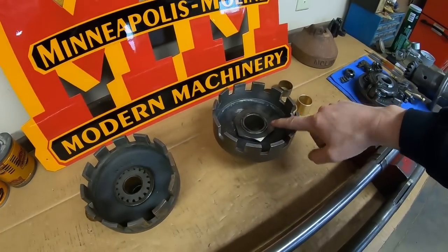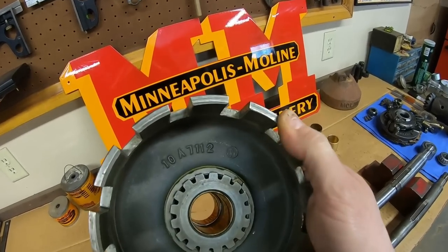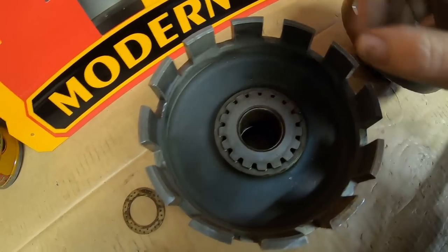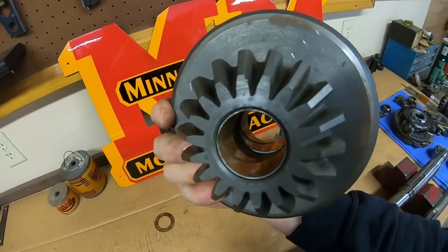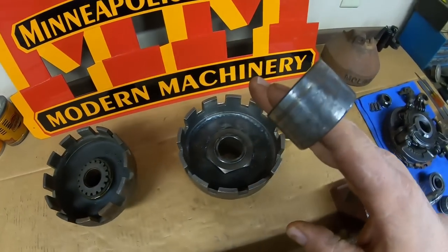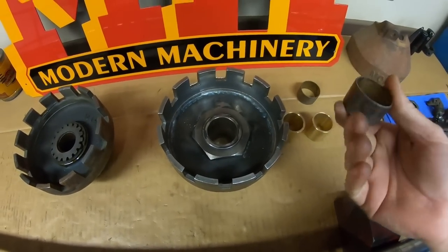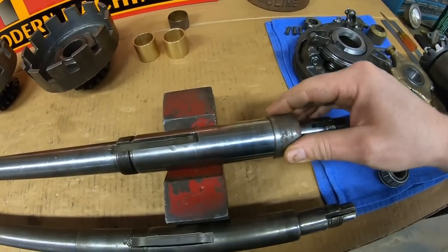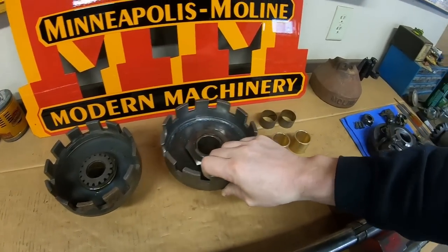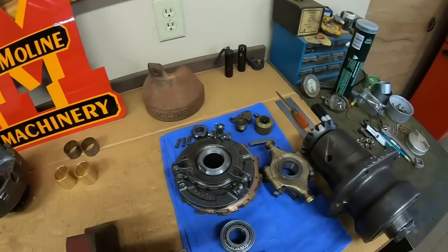Compare that with the production piece. We have no 10X numbers etched anywhere on this, but I know it's prototype. The production shell is one solid cast piece - we have a 10A7112 in there - but the gears are very easily removed, only held in by a snap ring. You peel that ring out and the gears slide right out the back. It's got those same very thin wall bushings on the inside. They're smaller in diameter than the prototype stuff, but these bushings did not hold up well. They've collapsed because they don't want to slide onto the shaft anymore - no surprise given how many hours the shell was pounded upon by that loose pull gear, and the clutch had blown up at least twice.